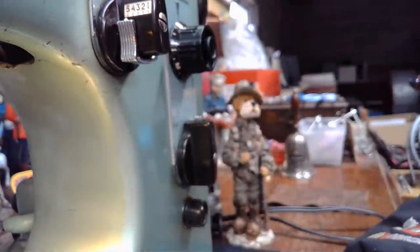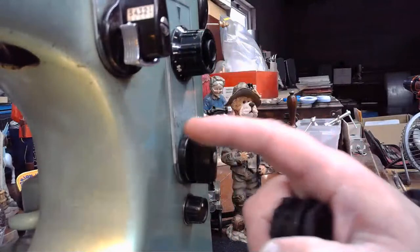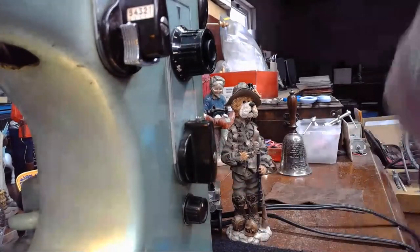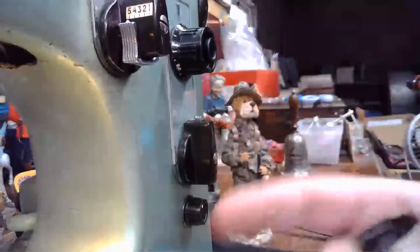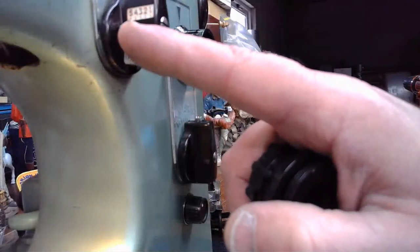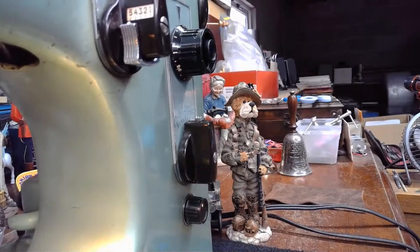But I agree with AW. When we manipulate stitch length and we manipulate stitch width to some degree, we can create and recreate those decorative stitches to give us a lot more than the bare bones of the 12 that we'll get right now when we look at three cams times four. Because again, the five is going to be a zigzag straight away. Hopefully that makes sense.